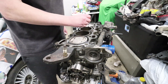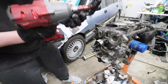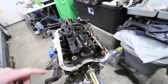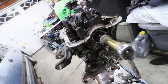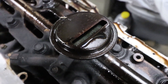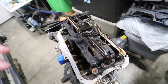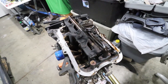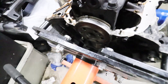This is where you would be numbering your pistons if you were planning on reusing them. Now that we got all this stuff taken off the side of the block, I went ahead and loosened up all the oil pump case. I want to make a note — yeah, this looks like trash and the pistons are no good probably, but there's no metal shavings up in here, so I'm pretty hopeful that this motor is actually in somewhat decent condition — the main bearings and the crank. Something else I forgot to do before I put this on the engine stand was take off the main seal bolts down there.